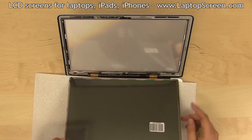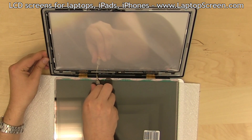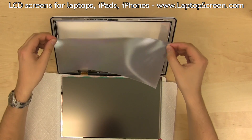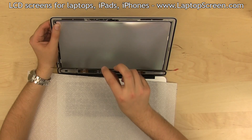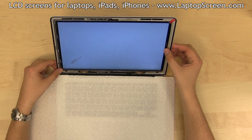Hold the power button to cancel the boot up. Replace two small Phillips screws on the LCD board. Remove the rear protective film, replace the plastic diffuser, and lift the LCD matrix in place. At this point, a second test can be performed.